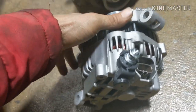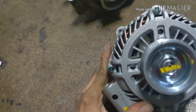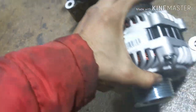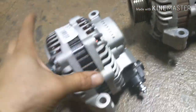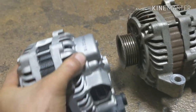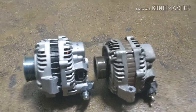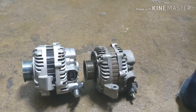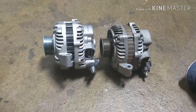Let's match it up — make sure they're all the same. Same thing here, same thing there. Now we work our way back. Pull the AC compressor to the side and shove it up there. Put a little WD-40 on the little bracket. If you took it out like this, now pop this out and put it on the alternator — clip it up there once you have it up there.